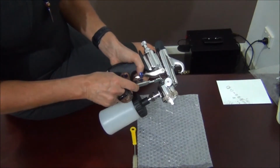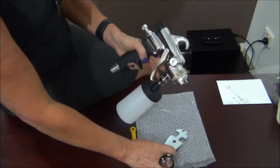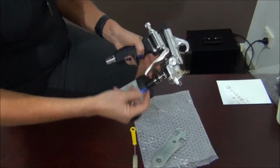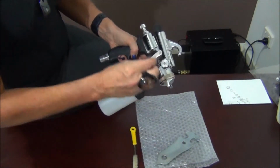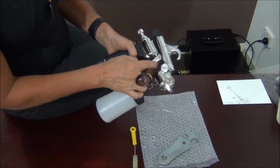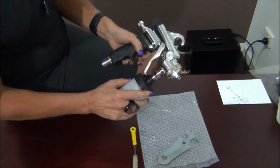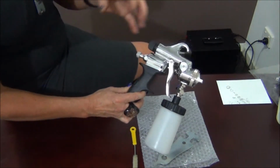Again, we're going to use our little utensil, pop it on there and give it a tiny little tweak, then plug it in, use our gun again and see if it leaks. So every tiny little move, test it and come back, because if you wring its neck, then all you're doing is splitting those tiny little gaskets and you'll need to replace them all. So when you pull your trigger back, you shouldn't get any leaking from there, otherwise this is just a bit loose, okay?